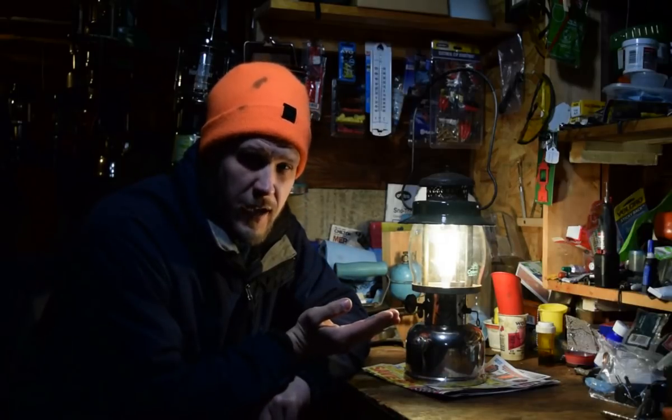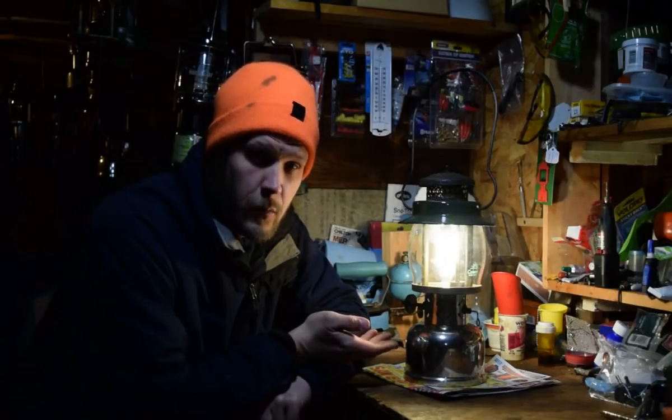They come with holes right in them sometimes. But I don't want to waste a good mantle before I know that the lantern's going to work right. So I like to throw a number 21 in, and if something happens, I don't really care. So I hope that we have dispelled a myth tonight. You can run a number 21 on a 237. It won't be as bright as with a bigger mantle, but you won't get overburn. It won't give a halo. If your lantern's burning right, your lantern's burning right, and it doesn't matter what mantle you have.